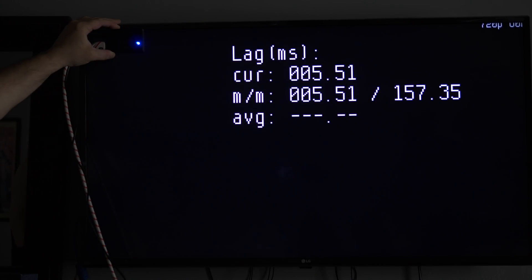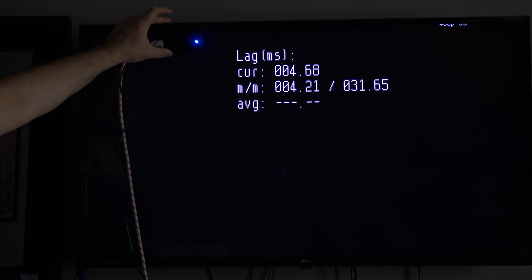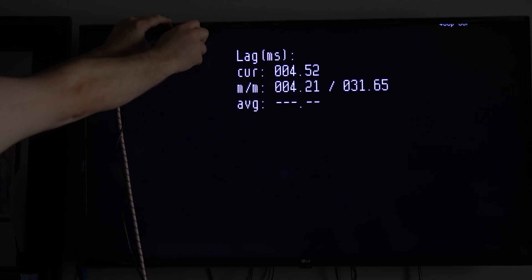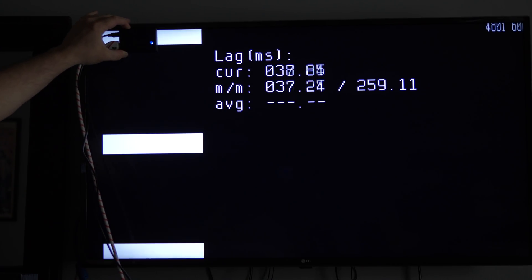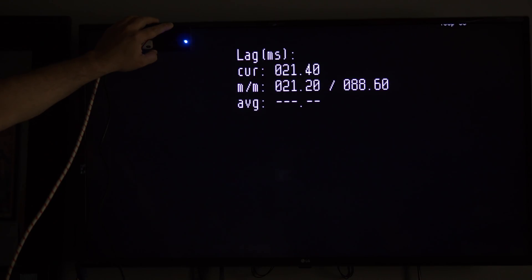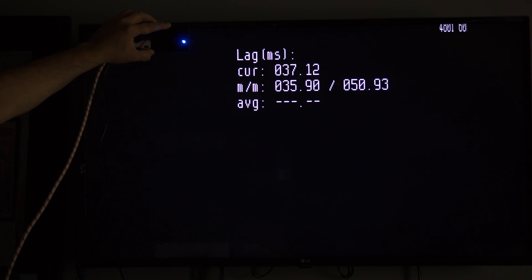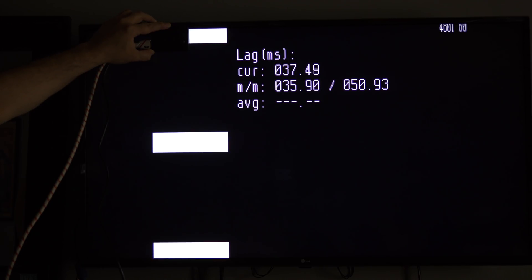To demonstrate, here's the TimeSleuth lag testing device on my LG TV. As I cycle through progressive scan resolutions, the lag stays pretty much the same. But once we switch to an interlaced resolution — 480i — you see a massive jump in lag, going from about a quarter of a frame to just about two full frames. Also, here's the TimeSleuth connected directly to this TV's component video inputs using one of the zero-lag converters I demonstrated in a previous video. On this TV, just using the analog input adds more lag on progressive scan resolutions, and interlaced is equally as bad as when using HDMI. Not all TVs will react this way, but this is why overall I recommend using a proper scaler for all analog signals. If you use a good scaler, you never have to worry about any of this.